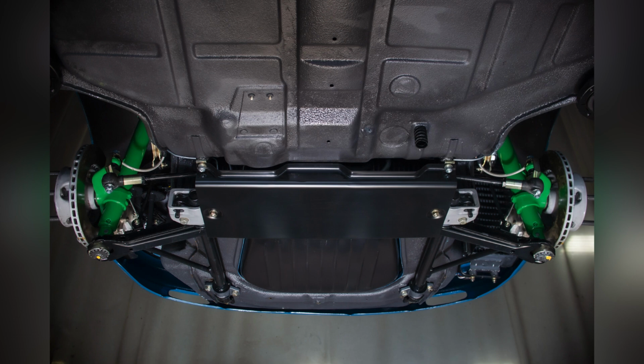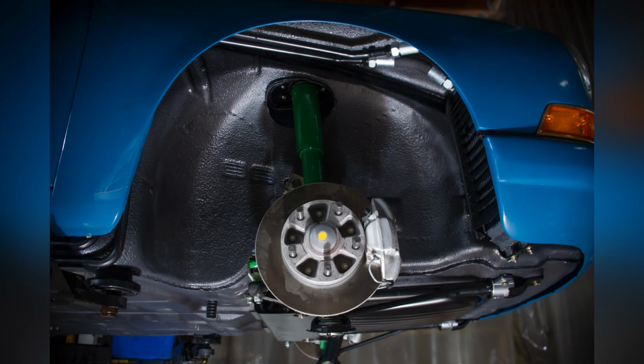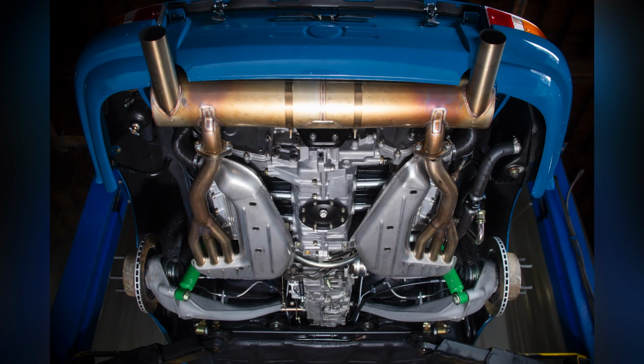The steering rack, of course, all restored. Struts are Bilstein struts, sent to Elephant, and spindles raised 16 millimeters, restored by me, repainted, restored by me, and then Bilstein HD inserts. Suspension in the back, you've got replated, restored SC adjustable spring plates, again with Elephant Sport rubber.